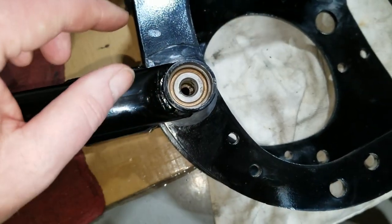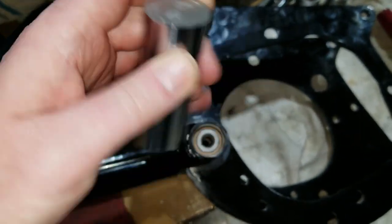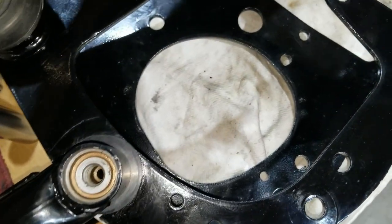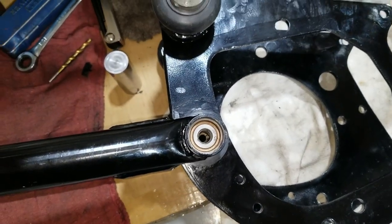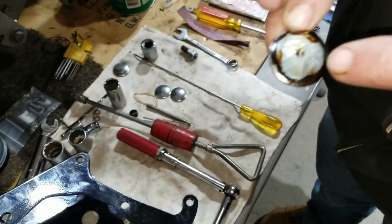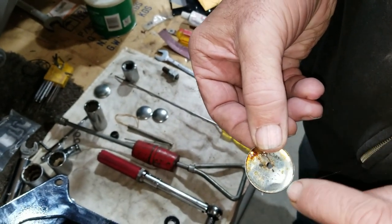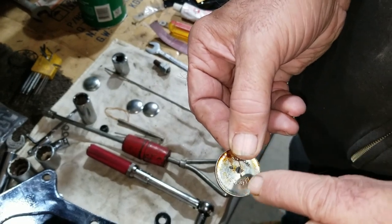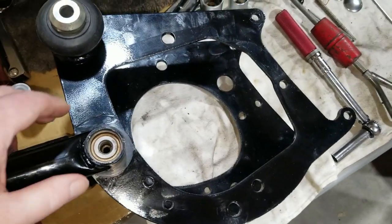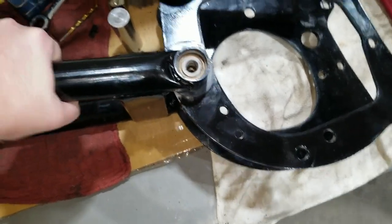We've got a special pressing tool that we made here, and we're going to use this to smash it and actually kick out the outer sides, because on the ones we took out, we noticed that when we punched in the centers, it only bent the center. It didn't really bend the outer sides. The outside is still curved, it's just dented in the center. We want to get more of the curve out, to flatten it out straighter. So that's what we're going to be doing right now. We're going to put the felts in, press one side, flip it over, and press the other side.